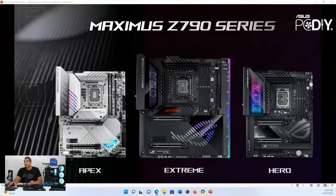But with two DIMM configurations, we're going to be able to see significantly higher DRAM scaling. I can tell you already internally, we have already broken 10,000 mega transfers. So really impressive in terms of the overall DDR frequency, and the overall uplift for Raptor Lake is quite impressive. I would say we're seeing 7,000 MT as the new normal, compared to 6,000 MT being the common target that we saw within the 12th gen series and Z690, when we're talking about an overclocking target when you're running XMP enabled memory. So again, these are our highest end configurations. I know that we've had some people asking about when the Extreme will be available.